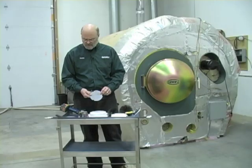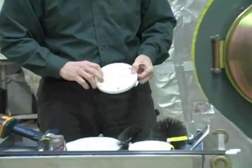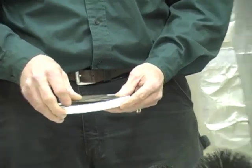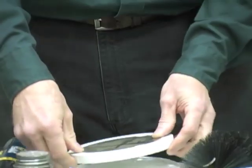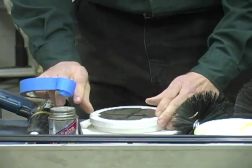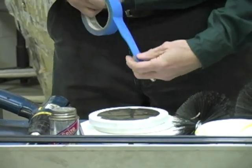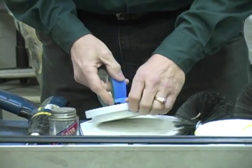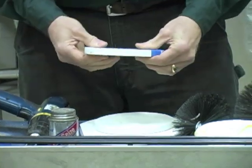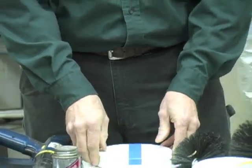This is the heat shield that goes on the lower left clean-out. That's because you've got a lot of particulate matter coming down the tube and it would basically sandblast the gasket off. So we put this — we call it a heat shield — on the gasket to prevent it from eroding. The right one does not need that because that tube is under suction. You just line up with the holes in the gasket with one section of tape, and that will keep the heat shield from bottoming out on the weld so it doesn't seal properly. All it takes is one section of tape like that and basically you're ready to go.